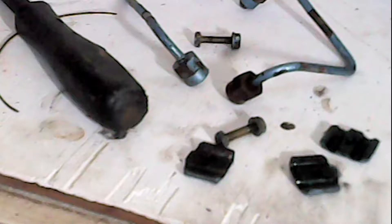The thermostat housing is actually in the exhaust manifold, so not an easy reach. I thought I would find exhaust ports that were completely plugged, but we really didn't find any plugged ports. The exhaust manifold will need only minimal cleaning and decarbonizing — everything will be fine. These are the fuel injection lines going to the fuel injectors, and also the bypass bleed.